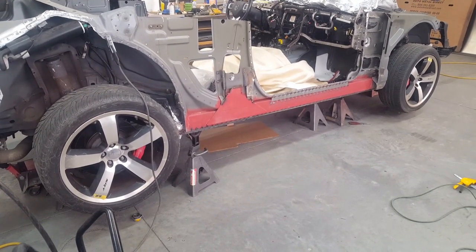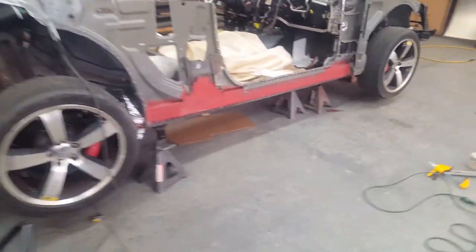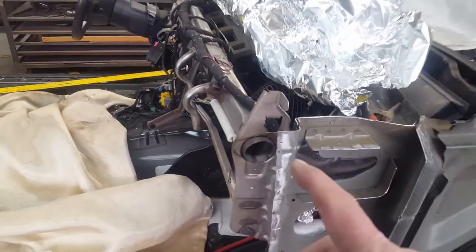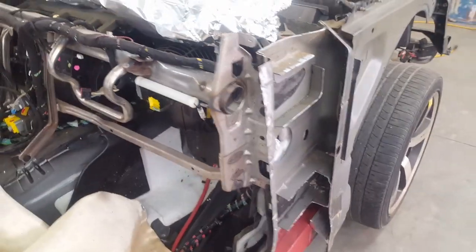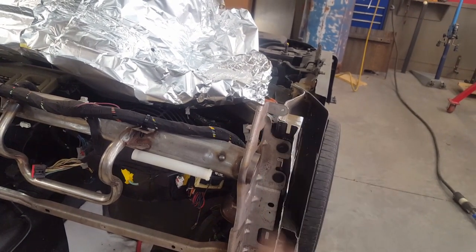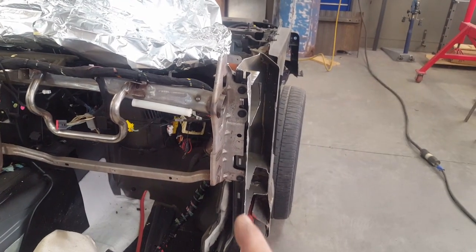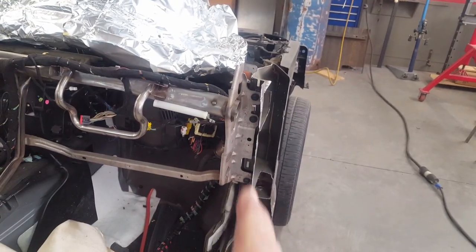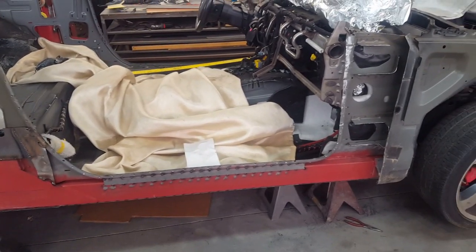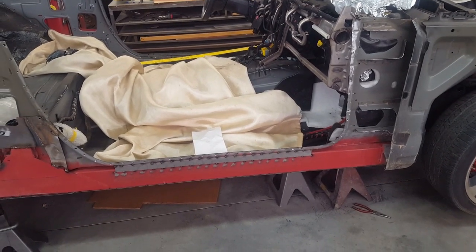The right side frame rail is done, so we're moving on to the next stage, which involves a lot of figuring. We've got to go over to the old car, make some patterns, and figure out how much of this area we have to trim out. We also have to figure a way to re-secure the dashboard subframe by moving these bolts off of this, since this will be substantially trimmed away because of the taper of the old-style door jam as these go vertically. This video's going on a little long so I'll end it here and pick up the next phase in the next video. Thanks.